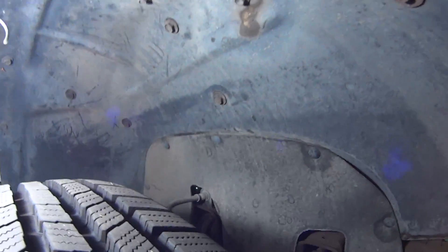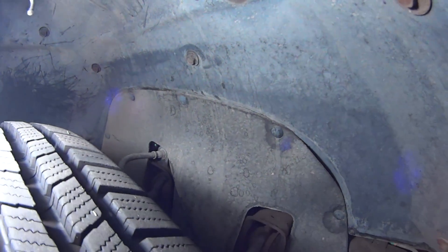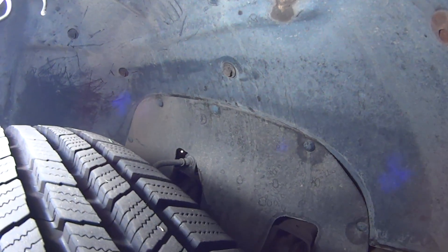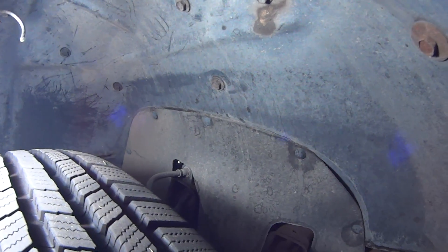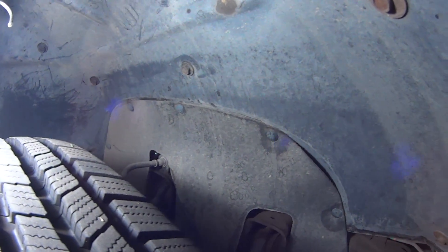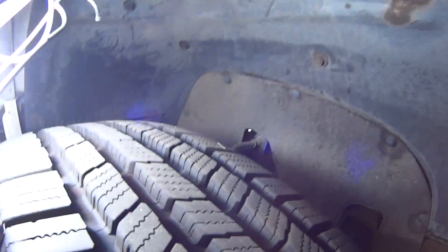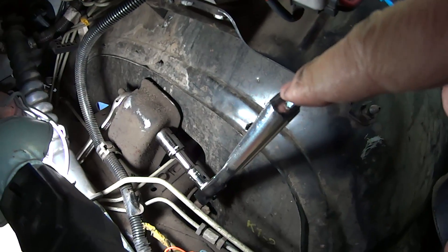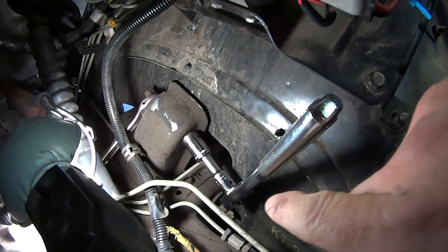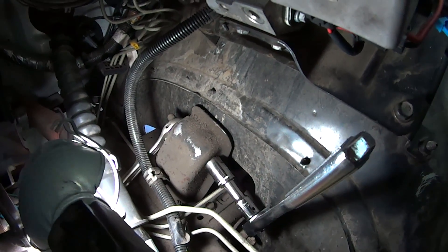The first thing I want to show you is that when you look under the wheel well, where you'd expect to find the shock mount, you're going to have this baffling. Now these trucks are fairly old, so some of yours might not have this, but mine does. I don't want to remove it because you'll never get it back on the same way it came off. So I'm looking for ways to get to it — and it's very easy. I have a half inch ratchet with a three inch extension and an 18 millimeter socket.